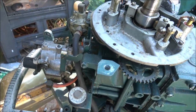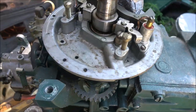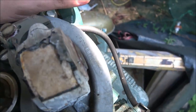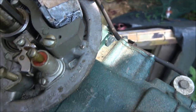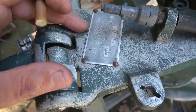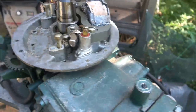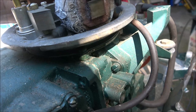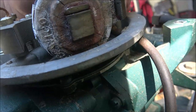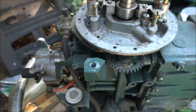That should be up against there, and then when you throttle it up it goes up like that — looks to be in decent shape. There's a number here: FW2255. I don't know if that'll help me out. I've got a serial number but there are some other numbers on the bottom I need to look up to find out if I can still get parts for this thing. I did look online a bit — some guys were saying you can swap coils from a Johnson, which is an Evinrude, but only on the smaller engines, not the 16 horsepower.